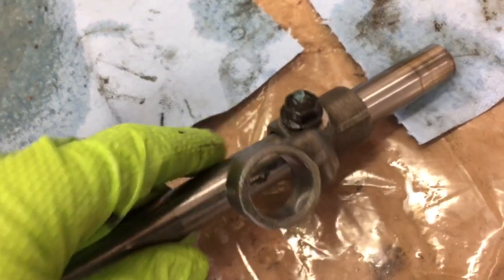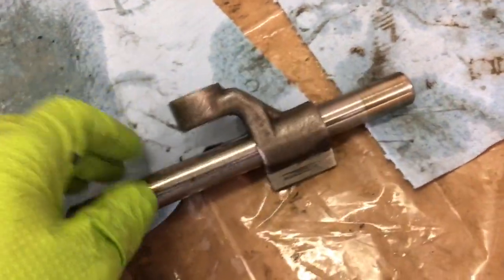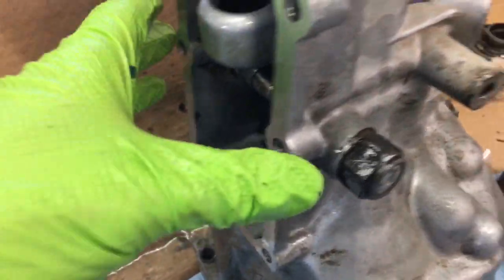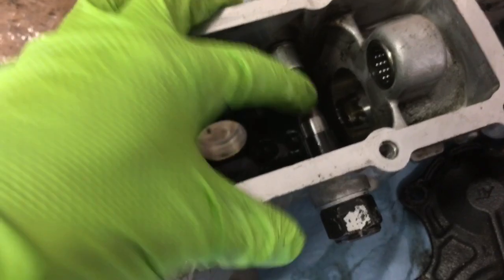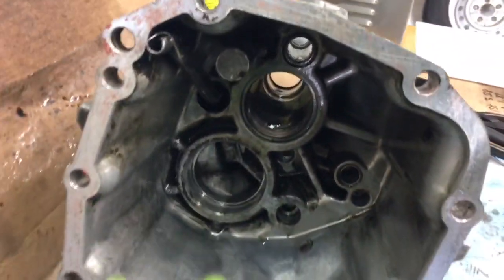What you've got to do is take an impact gun and back this out, then slide this affair out of its little retaining thing, with its little bushings and bearings. You need to pull that out and it will let this piece come out. You don't need to take these out — this is what keeps the shifter from flopping all over the place. I've also removed the speedometer cable pinion. I'm just going to clean up in here.